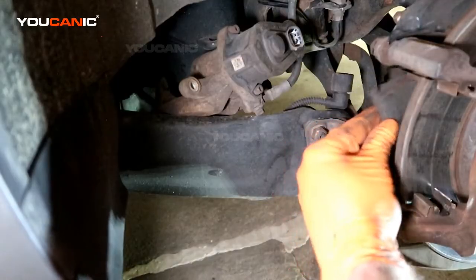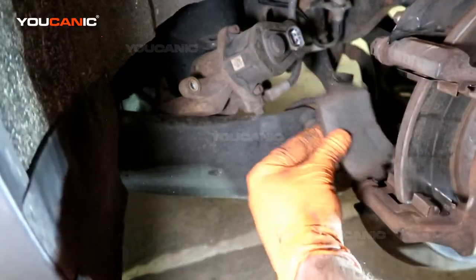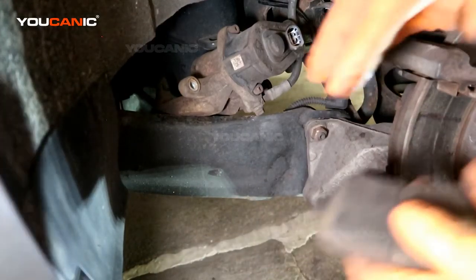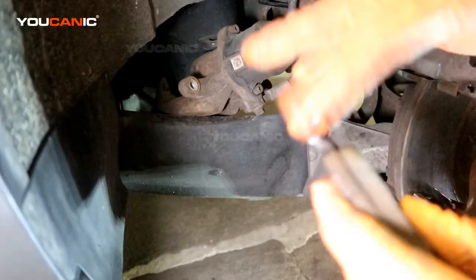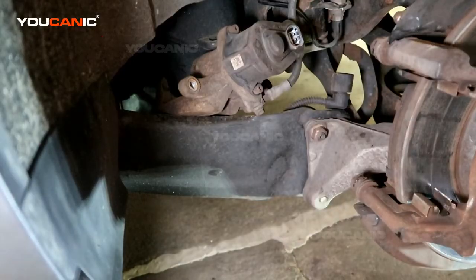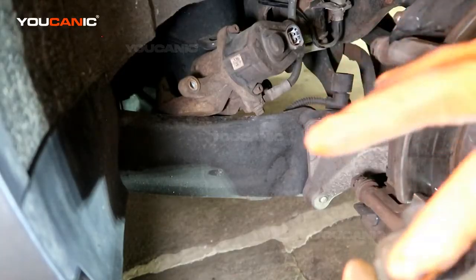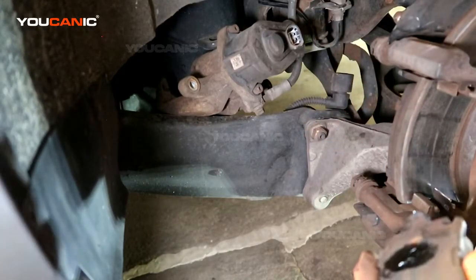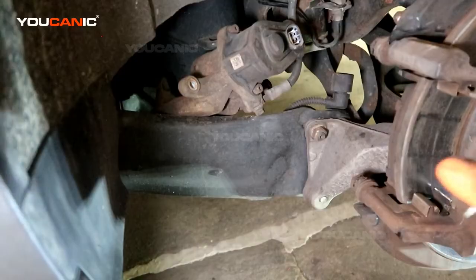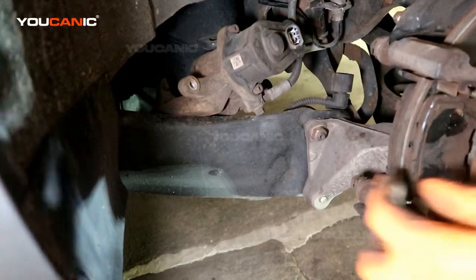So you just take your brakes and put them the right way that they go, with the curvature. Then I'm just putting a teeny bit of caliper grease right there. We do our best not to get it on the front, because then our brakes won't work as well on the friction material. Some would say you put a teeny bit here and it'll keep some of the rattle out of your brakes, so they won't be loud. There we go.